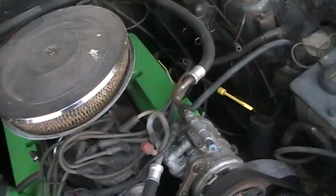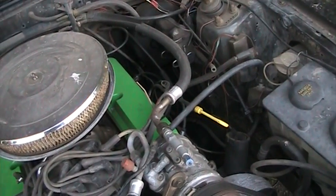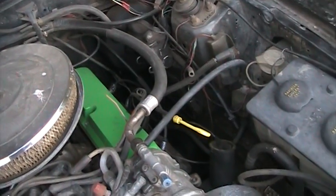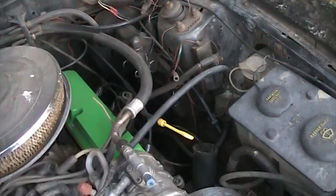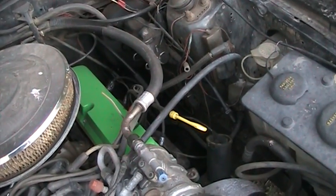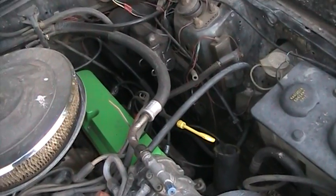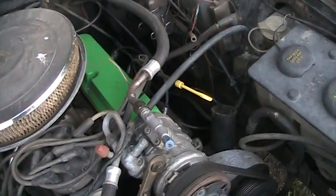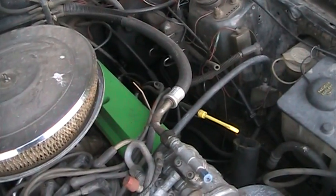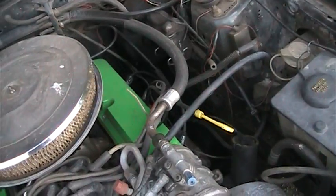Basically, the carburetor would fill up, and it would go as far as the carburetor would go, and then it would just idle. That's all it would do, because that's all the faster the fuel would come up through the fuel pump. I took air pressure and blew the lines out, and it worked for about 5 minutes, long enough for me to get up the road a little ways, and it started stalling out again. Wouldn't pump fuel. I'm not sure if it's just the fuel pump's not wanting to pump right anymore, or if there's crud in the lines.